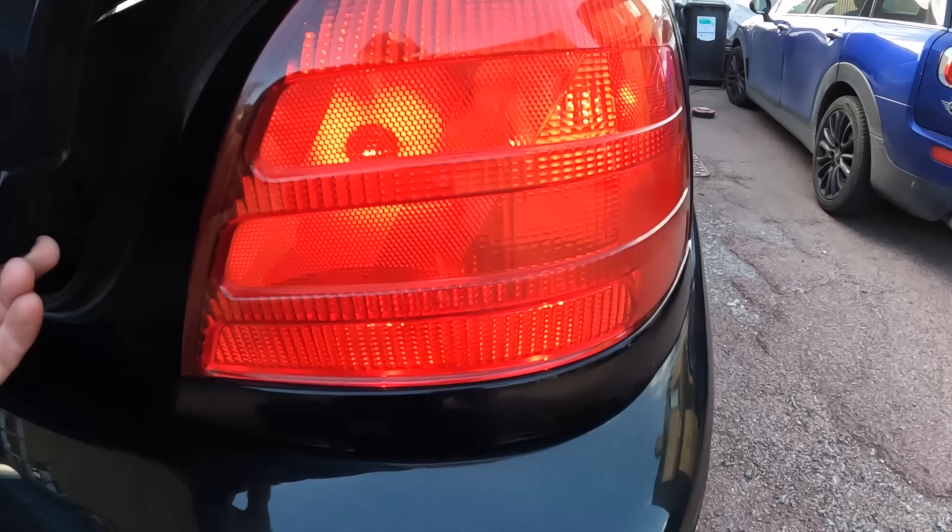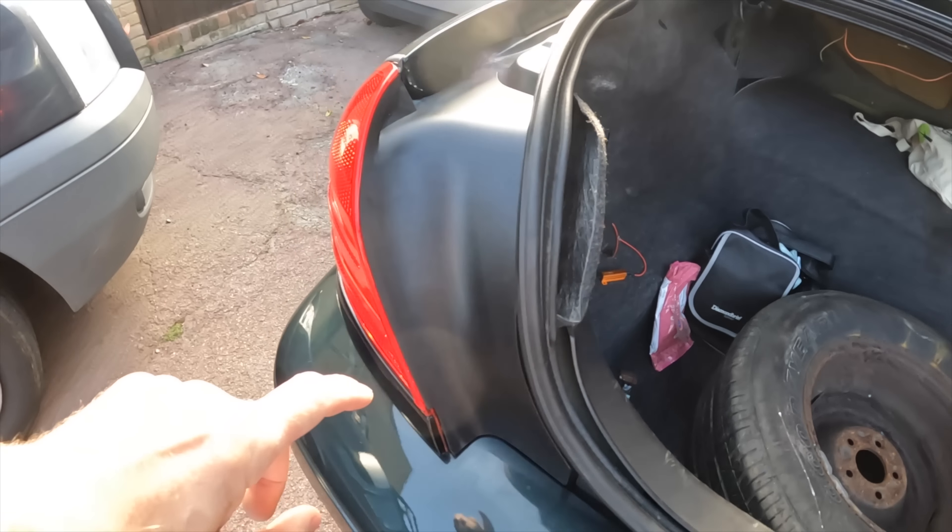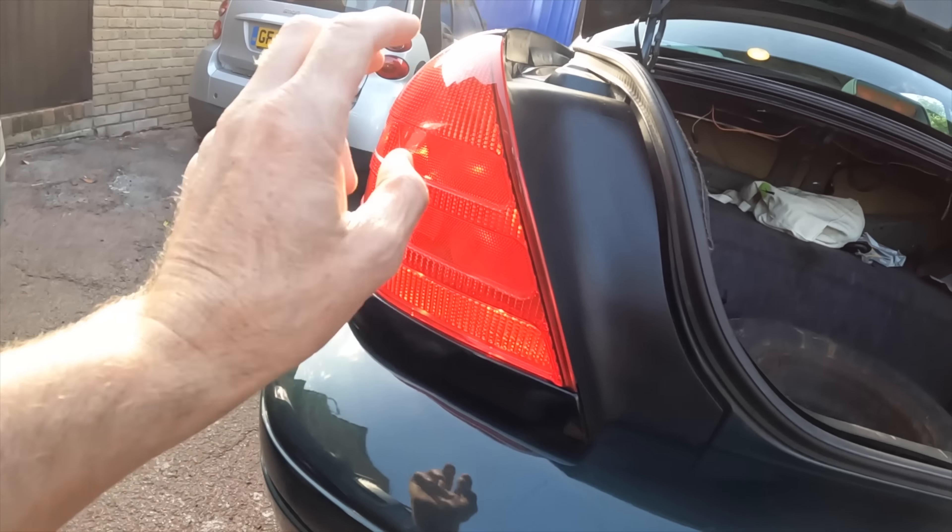When I first brought this car over, I thought what I did was quite clever. I cut the feed which mixes in here, so previously it only had two light bulbs on top for the brake and turn signal all in one. I then drilled holes in the bottom to make two more light holes, put two more bulbs in there for the indicators, split the cables around the back, took the brake light feed, and converted it to LED. I fitted green LEDs because green through red shows amber — bizarre I know, but that's how science works.